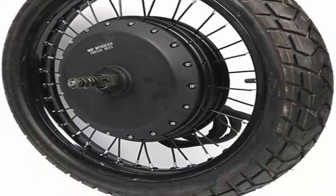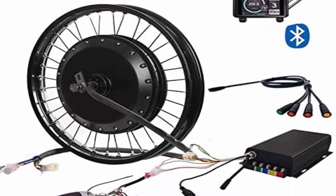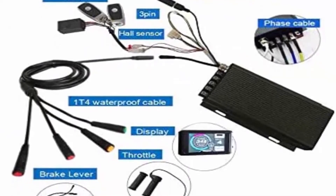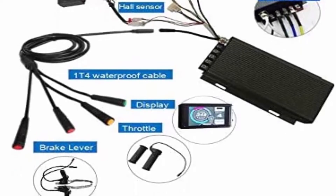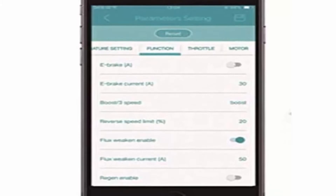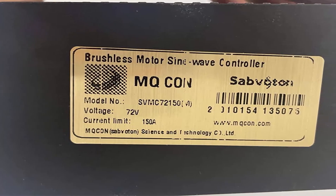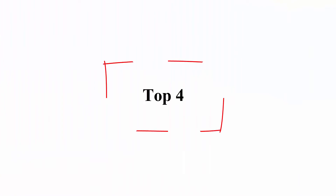Functions include: cruise function, e-braking function, regenerative brake function, voltage, DC current, e-brake current, flux weakening open/close, flux weakening current, regenerative current, and temperature protection settings for motor and controller, plus error types. New design TFT colorful LCD display with alarm lock — all parts use fast-release waterproof connectors for controller, display, throttle, and brakes.